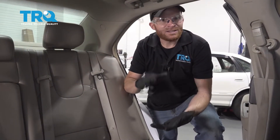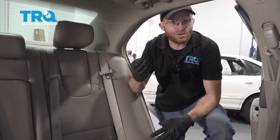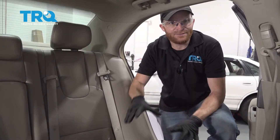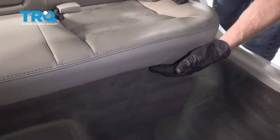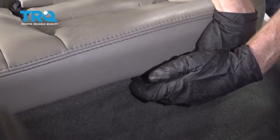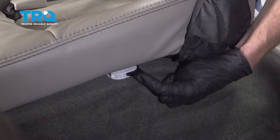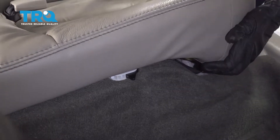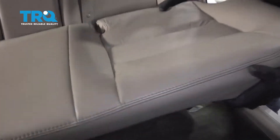After you're sure you only have half a tank of fuel or less, go ahead and put that hose back on and tighten the clamp. After that, get inside the back seat of your passenger compartment. We're gonna remove this seat right back here. As I run my hands along the bottom, you're gonna feel there's a little nub you can grab onto. Once you grab it, you can slide it to the side and lift this up. Do that on both sides and then we can get this right out of the way. To slide it out from the back, you need to slide back and up and then you can remove it.